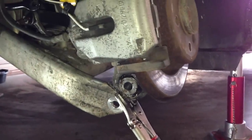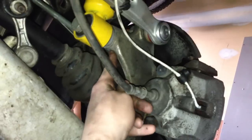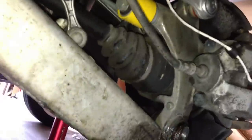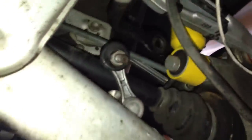To get to this stage, you are going to need to fight with this for a little while — it could be anywhere between 5 minutes and a few hours. I had to get a breaker bar and stick it in between the brake line and the bottom of the strut here. This takes a very long time to get right and a lot of thinking and general work. Once you use a breaker bar to get this down, you're going to need to clip it with a pair of vice grips. Make sure that this is resting on this right here and that you do have plenty of space left to get your ball joint out. I also unbolted my roll bar, which helped a great deal — it took about 30% of the force off of this H-bar here.